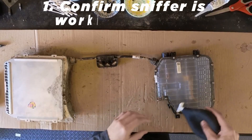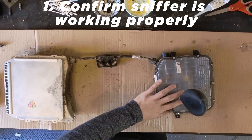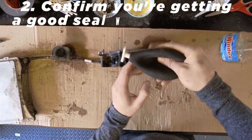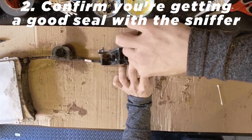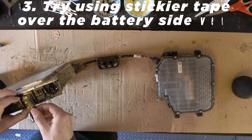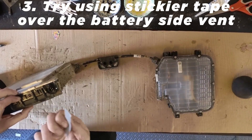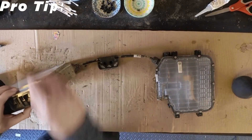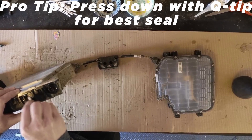First check: make sure the sniffer is working correctly. Just hold it against a smooth surface and make sure it doesn't inflate. When you apply the sniffer tool, make sure that it's perfectly centered on the vent and hold it firmly down. Replace the sticker on your battery box vent hole with a more aggressive sticky piece of tape like duct tape, and really push it on there very tight to make sure that there's absolutely no possible way that air could be leaking in through that vent.